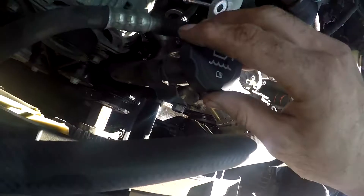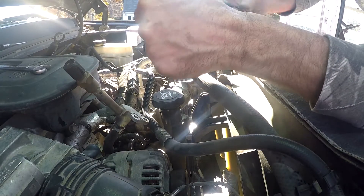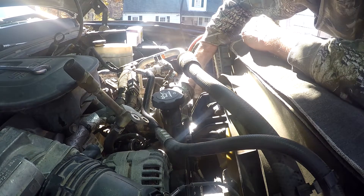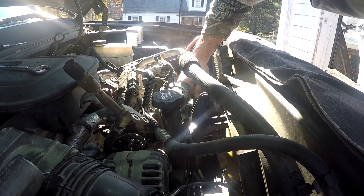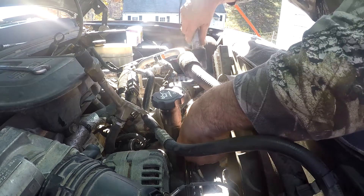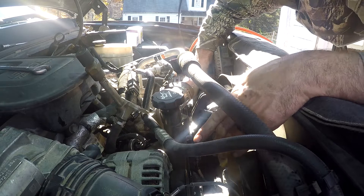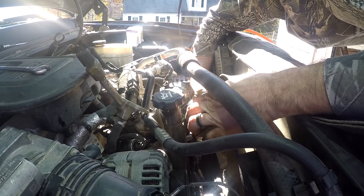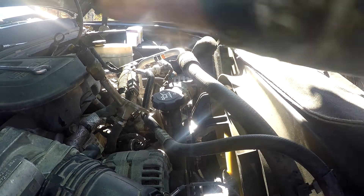The only other thing is there's a bolt here that holds the oil fill, and then there's also a 13 that holds the upper fan shroud on — you're only going to have to take out this one 13. You don't have to undo every fan shroud bolt. So just those two 13s — buzz them out real quick. For this one, I'll take my air ratchet and jam it between the AC compressor and the fan. With a swivel socket, it works ideal — you can get right to it and just buzz it right out. They're a little pain because you can't spin them out with your fingers; they've got blue Loctite on them. So it does help to have the air ratchet for sure. Try not to drop your bolts — that's always a pain.